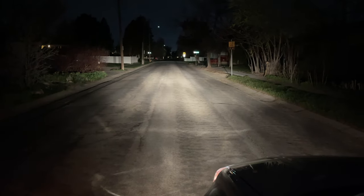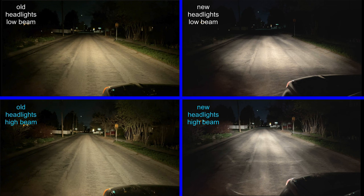Are they better? Let's do a comparison. In the upper left corner of the screen we have the old low beams. The light is yellow and starts at the front of the car — you can see the grass and a bit of the sidewalk. The new low beams look brighter because they're white, but notice the beam is both shorter and narrower. It's dark by the car and you can't see as far. The grass, sidewalk, and road signs are not visible.